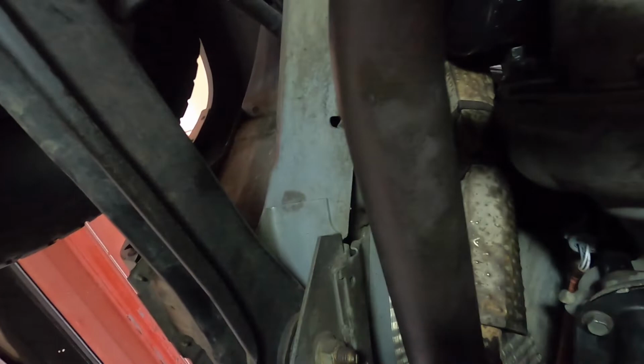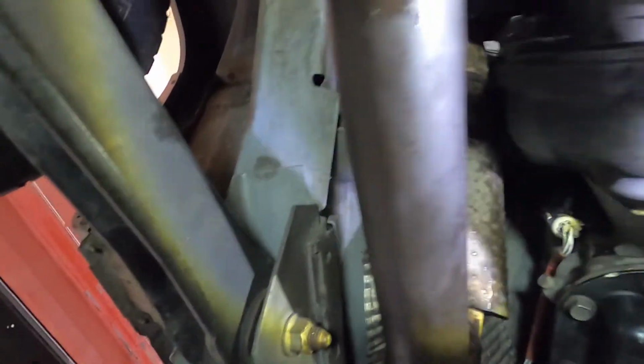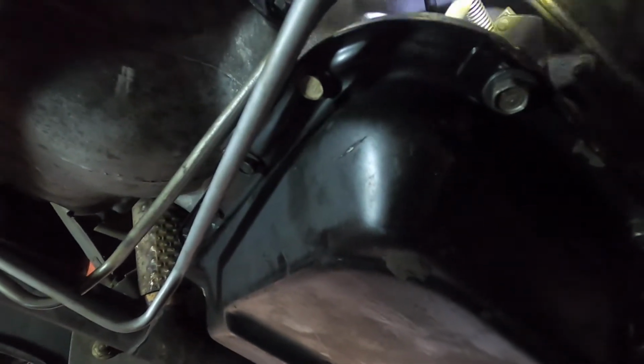and we even got our little bracket there to hold our hoses, which we will put up there shortly. But that's all back in, dust cover is all back in. That is all good to go. Okay, next we're going to come back over here. We're going to get this bracket installed properly, the shift linkage bracket, and then we're also going to get the actual shifter assembly installed back into that and connected back up right there.